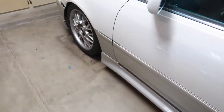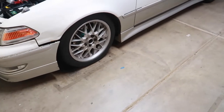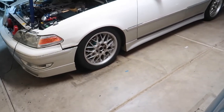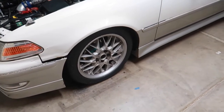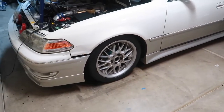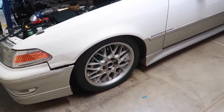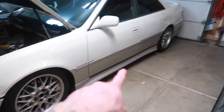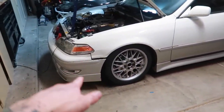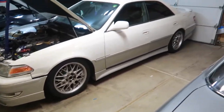On that note, the most important part of a braking system is your guide pins. Forget the piston, forget the pad, forget the rotor. Guide pins are everything. And also on that note, on my own free time, I'm going to take all the guide pins out, re-grease them, clean them up all nice, just for peace of mind so I don't ever run into that issue again, because I am not spending another $300+ on rotors.